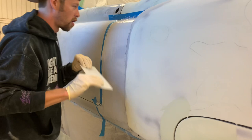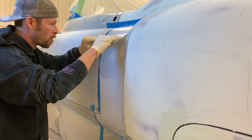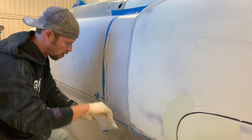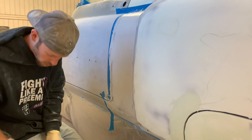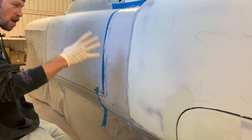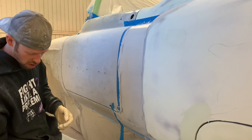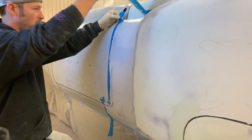What I like to do is get it roughed on there, then take one of our spreaders and spread it so that one side of the spreader is on the door and on the next panel, so that any little variations I need to fill along the door will be filled — hopefully in one swipe. The idea is to spread it thinner to begin with, but only where you need it, rather than leaving a bunch of lines that you'd basically be sanding all off.